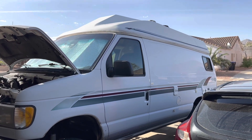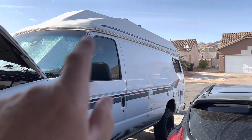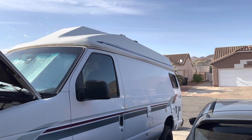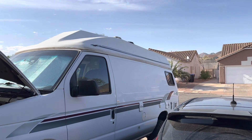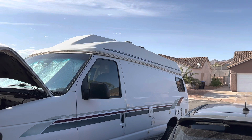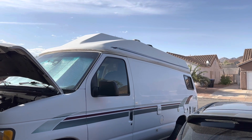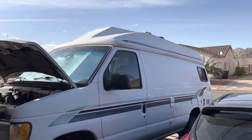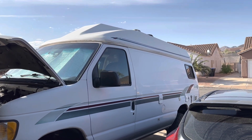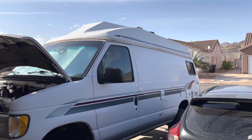The video cut out on me earlier, so a couple of last things: I got a better extension cord and plugged in AC power to start testing the van's systems. The rooftop air conditioner works really, really well — I was very surprised. It was about 100 degrees outside when I fired it up, let it run 20 to 30 minutes, and it was kicking out cool air at about 53 to 55 degrees. It makes a little bit of noise, but that seemed normal for an air conditioner.